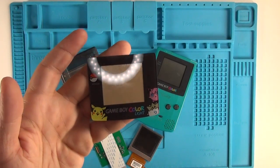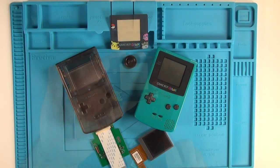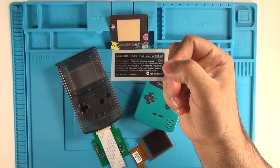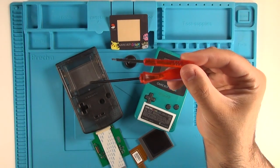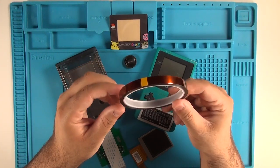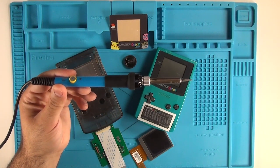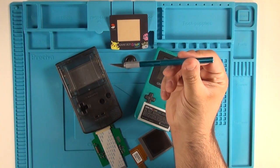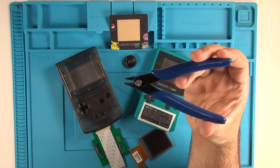Up close you can see it is a slightly different shape than the original Game Boy. Next, we're going to get a replacement rear label, which actually comes with the Freckle Shack kit as well — really nice to see. For tools, we're going to need a tri-wing screwdriver and a Phillips head screwdriver, some Kapton tape to insulate the electronic components on our boards, a soldering iron (only if you're doing the speaker upgrade), an X-Acto knife or craft knife, and a pair of precision side cutters.